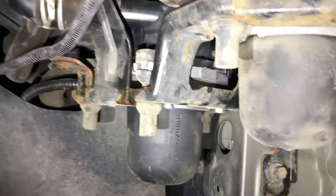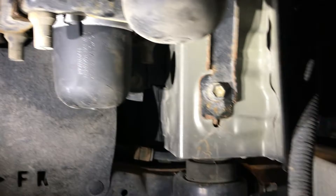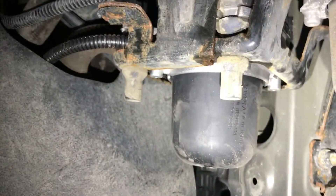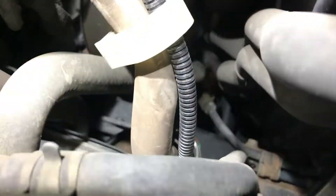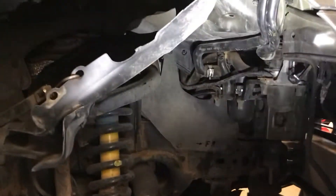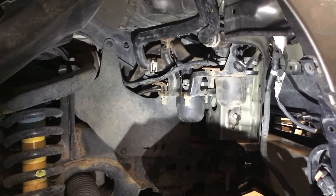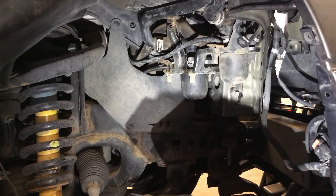After getting the pump in, tighten the two bolts and two nuts and double-check to make sure everything is nice and tight, and that the wiring is not crossing any bracket. Looking good. Make sure we plug in the wiring in the engine compartment properly and install the clip back so the wire isn't flopping around. Now put back the cover with the clips — most clips break on removal, so replace any broken clips before installing the wheel.